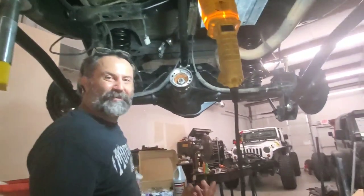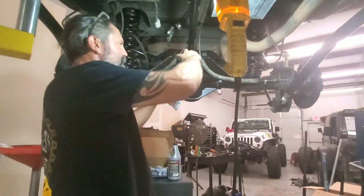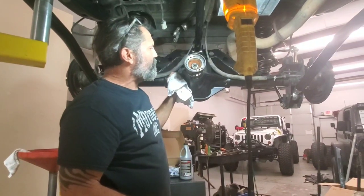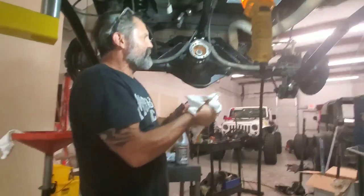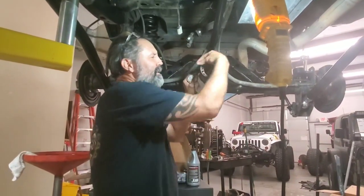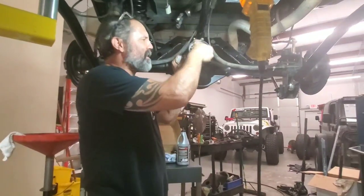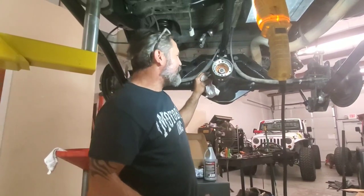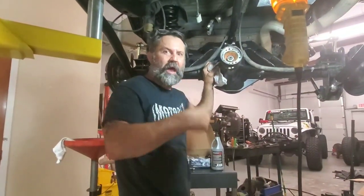That is really how easy it is — that is just perfect. I've done it several times so I know exactly where to stop, but that's it. The crush sleeve is crushed. We're going to leave it like this, get our rear end set up, then install our seal and put it back together. That's how easy it is with an electric impact — no big bars, no three people. The trick was just lubing the washer and the nut. This is Diesel with Jeep Style — please share and tell your friends. Thanks to my son Dylan for videotaping. Have a good night, hopefully this works for you — let me know.